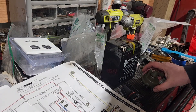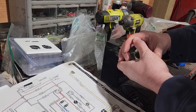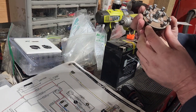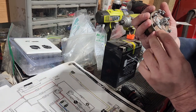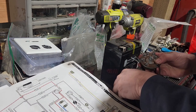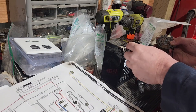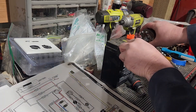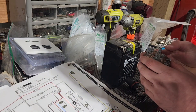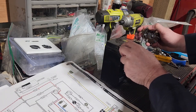I've got my wiring diagram here and I am going to see if I can test the switch and see how it's working. So first let's test the headlight — I'm looking underneath here and they embossed those labels. I'll put that on ground and just touch that, and it works — nice! I think we're going to be good to go with this original switch being fully restored. I continued testing all switch positions to verify that they worked.